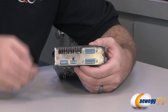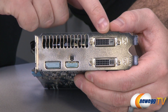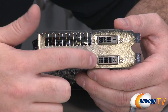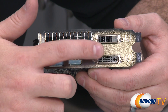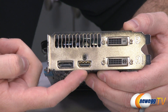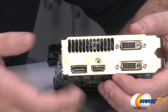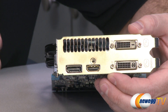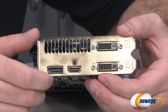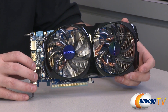Around to this end we can see the video connectors. You have two dual-link DVI connectors — the upper one is digital only, the lower one is digital plus analog, and both can do 2560x1600 resolution. If you're using a DVI-to-VGA adapter, use it with the lower plug. You also have an HDMI port and a DisplayPort 1.2 connector. This card is NVIDIA Surround capable, so you can power up to four monitors — use three for 3D gaming and a fourth as a companion monitor.